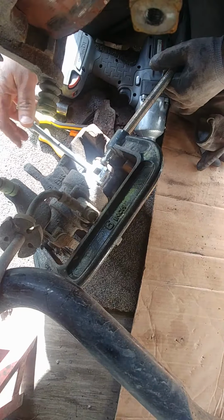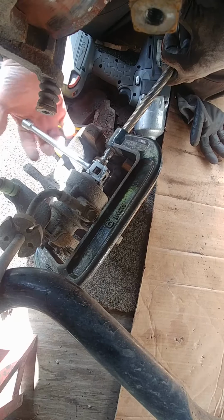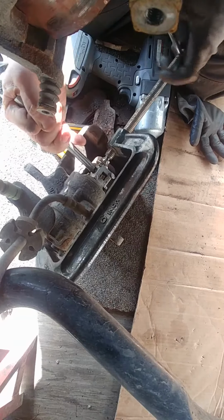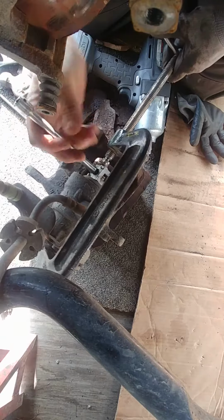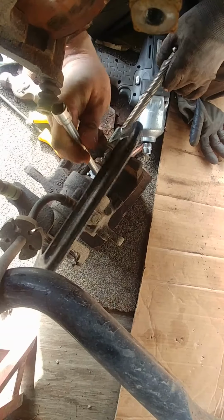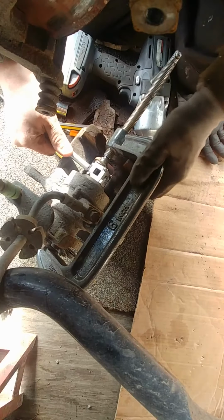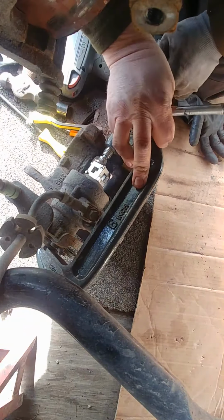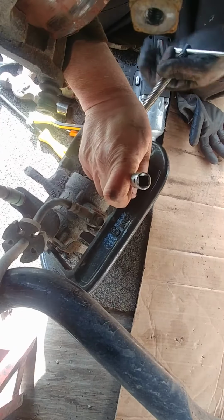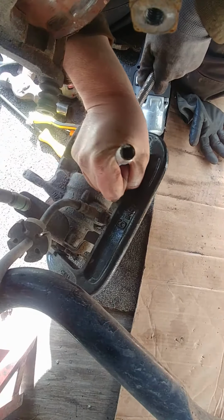Okay, so hopefully you can see this, but as I turn this handle to the right, put some tension on that piston, take this 3/8 extension in that adapter, and as you turn one, I'm sure it's going to block the vision here. As you turn one, you turn the other one the opposite direction, and it will eventually take that back in, and it really is pretty seamless. It doesn't have a lot of pressure on it, and it does not cause a lot of issues, but there is a little positioning game that you have to play for a few minutes while you get everything set up. But as you turn it, turn one, keep tension on it, and turn the other, that piston will go right back inside, no problem.